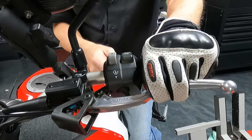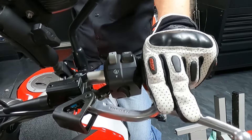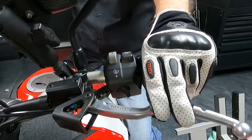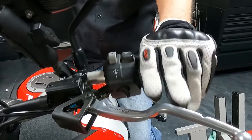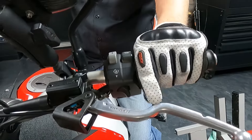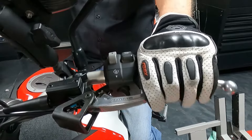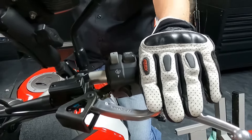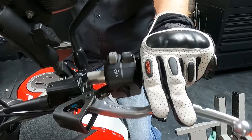What happens is you pull the clutch in and it stops moving because the lever is hitting your outer two fingers. Even if you use shorty levers, the end of the lever will still hit that finger. So this is all the motion you need to make a clutch work properly. Especially in motocross or riding a sport bike in the twisties, you can still work your clutch but you've got a great grip on your handlebar. If you're using all four fingers, you've got less stability on your handlebar.